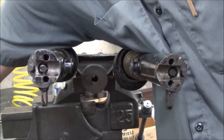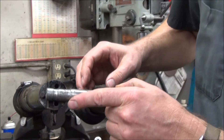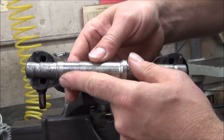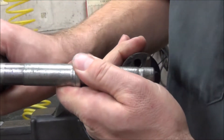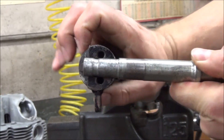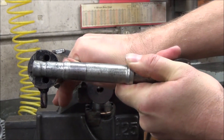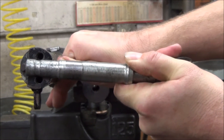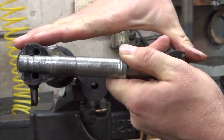And here's a later axle — basically 69 and onward. If we line up one set of bolt holes, there's going to be quite a bit of pressure to get it out. But it's possible that a guy could spread the forks far enough to get the bolts in, unaware that this is the wrong setup, because they're all very close to one another.